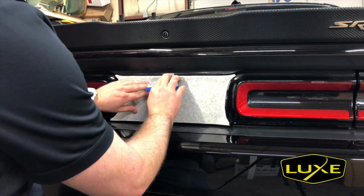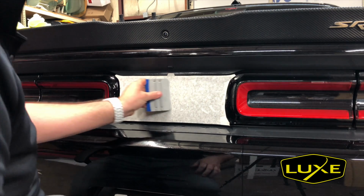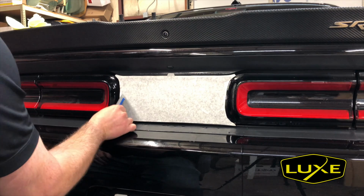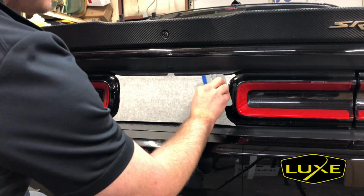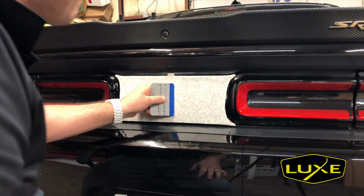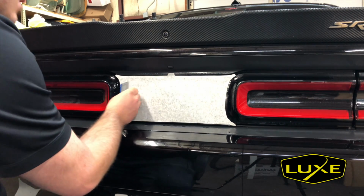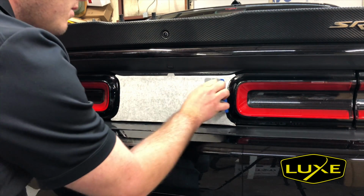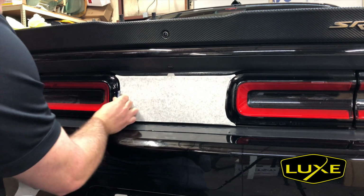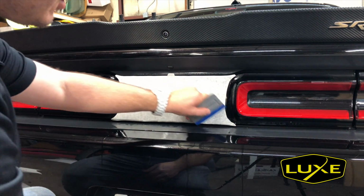Take the squeegee. I'm gonna run it straight down. That was hardly any pressure. Straight across, across. Now on the bottom corner, this bottom corner, top, and top. Okay, now that I've got it basically applied, not using much pressure at all, I'm gonna flip, and now I am giving a lot of pressure to my strips. Again, we're trying to evacuate the moisture from behind this decal. So keeping that in mind, work the way that you want the moisture to go.